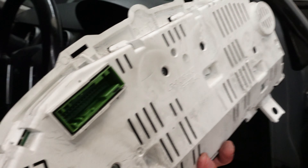All you really need to do is carefully start pulling the cluster out. You need to kind of pull it and push it down — if that makes sense — and then it should start coming free. There are two little markers which guide it. Push it up and pull it down a bit — there we go, it seems to be moving.